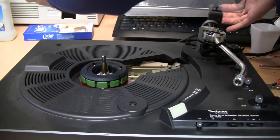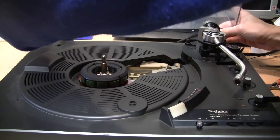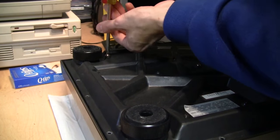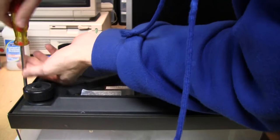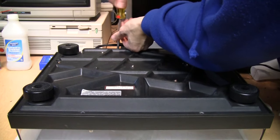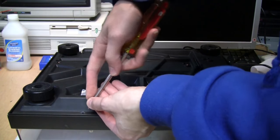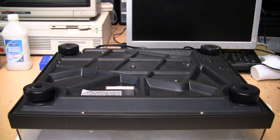Reinstall the dust cover to give it something to rest on while it's upside down. Make sure you didn't knock anything out of place. Now reinstall all the screws removed from the bottom, starting with the longer ones in the corner, then all the ones around the edge. I like to crisscross the screws — just like putting lug nuts on a car — alternating sides rather than going all the way around, to ensure even tightness. May not be entirely necessary, but it's a good habit.